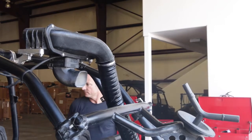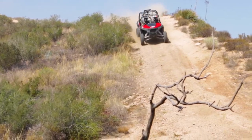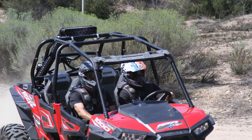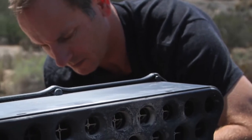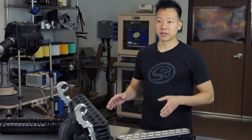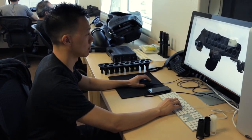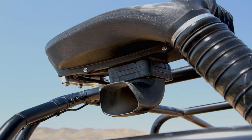One of the biggest problems in the UTV industry is that there's a lot of dust where they're driving, and filters get clogged very quickly. We usually just do air intakes and air filters, but we wanted to actually separate the dust out of the air before it even gets to the filter. We looked at a lot of different technologies — cyclonic separation across many industries, from big dust separators for agricultural use to what's going on inside modern vacuum cleaners. We did extensive testing and experimented until we were very happy with the separation performance and percentage.